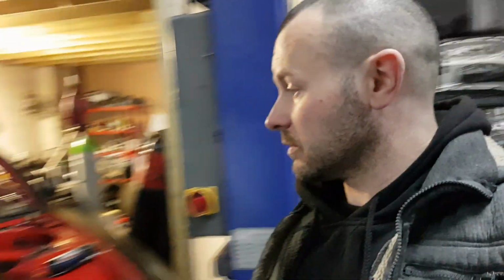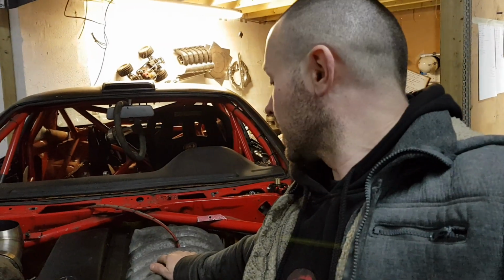Surprise, surprise. Now, many of you know, many of you don't. For who does, look someone else. For who doesn't know, I present you the mighty OM606 turbo diesel Merc engine. Now this one originally, it's not electronics free. It runs on ECU, it runs a few sensors, but it runs on a mechanical pump which is controlled by the ECU. Now you can swap that pump with the one which is completely mechanical from the model before this engine, and you just direct swap.